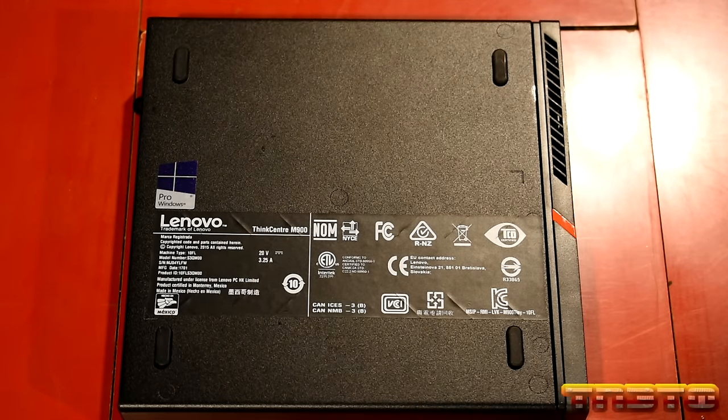So what you have is the main heatsink fan. This easily comes off. You have a tray to put a 2.5 inch hard drive or SSD, and this comes right off. You have your heatsink, and then under it, you'll have access to your M.2 slot and to your RAM, okay? So let me go ahead and take this hard drive tray out. This tray comes out very easily.